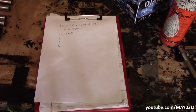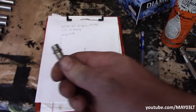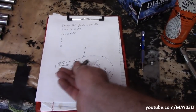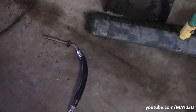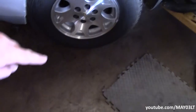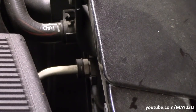Got my line swapped out — we're ready to start doing this flush. They sell these GM cooler fittings; I think Summit Racing has them. It's just a little plug you can push in and then put a 3/8 rubber hose on here and clamp it down, and that's going to give you your connection into the radiator. But I've got a different idea — I just pulled this cooler line out of the truck and it gives me a fitting on each end. What I'm going to do is disconnect the upper cooler line at the rad, plug this in instead, stretch it all the way across the front of the truck, put a little rubber hose on it, and have it go into a bucket so I can monitor it right here from the driver's door.